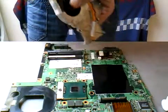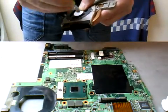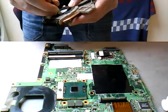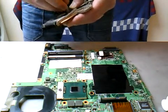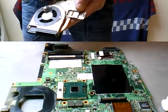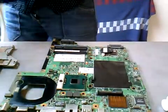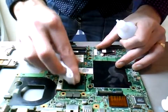You've got a nice clean fan there. Just give it a little rub around and then the same on the back as well - cleaning away any build-up. The reason they get hot and things start to slow down is because once the fan is clogged up, it's having to work far harder to keep the laptop cool, and that is when the problems begin - your laptop becomes really uncomfortable to handle. Just give the fan as thorough a clean as you can. Clean the contact plate so you're left with a nice clean surface on there and on your CPU. Clean it off so it's absolutely pristine and ready for the thermal compound.